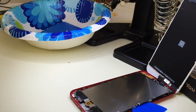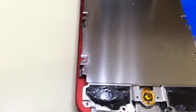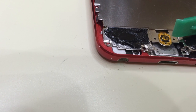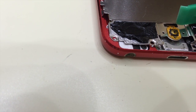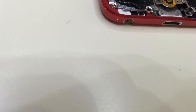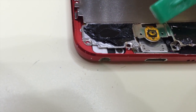Okay, one more thing to do, and I'll take this camera from this device so you can take a look. Camera, it's actually my iPhone. See the home button over here? I'm going to point that out. It's glued in, so I'm going to go get my tweezers and actually pry that open because it's on the shield. So I'm going to pry this open a little bit with the X-Acto knife and then pull it away. Otherwise I won't be able to pull the shield. That's something I'm glad I saw with this magnifying glass because it's hard to see. It's kind of sticky, so I'm sure there's adhesive all over it, holding it down, and I will do that and come right back with how I managed to get it out.